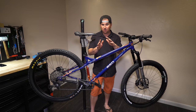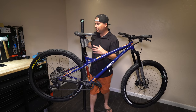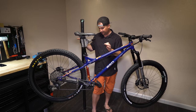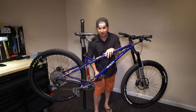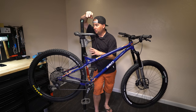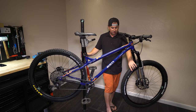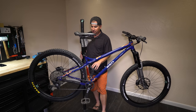This is not the complete bike you're going to get when you order one — this is Alex's personal bike with some of my parts on it too. First off, huge shout out to Hunt Wheels. They sent in some Enduro Wides for this build. They're 32.5 mil inner width, which I love — very economical, quite light for the price, really fast engagement. That inner width is great for the 2.4 to 2.6 tire size. Up front I'm testing out a Goodyear Newton 2.6, and out back I've got a trusty Maxxis DHR2.